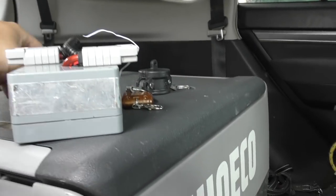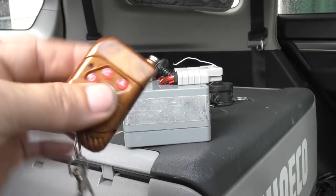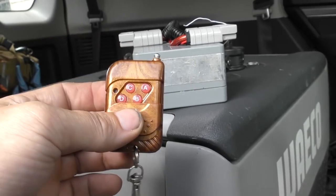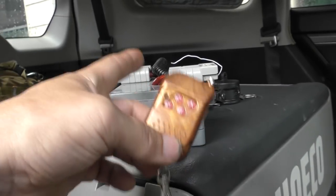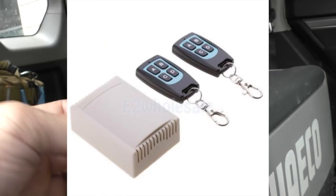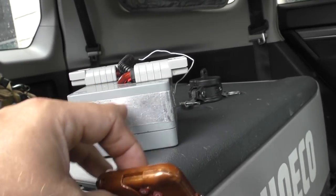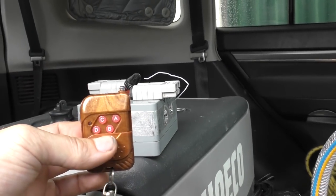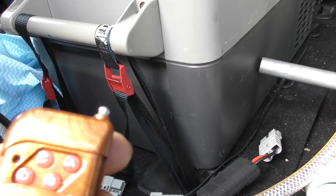I have my remote Anderson box, which works off this remote control. These are available on eBay for about $10 to $15 — I'll stick a link below. The single-button ones are what I'll swap in for the fixed-mount air compressor. Inside this box is an input Anderson plug and an output Anderson plug, both going into a 60-amp relay, triggered by one of the little 10-amp relays that comes with this. I've fitted everything into one box. Basically I can plug this into any Anderson plug and have it on remote control — whether that be lights, the air compressor, or in this case the little pump — so I can switch it on or off in an emergency from my pocket.